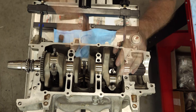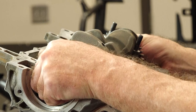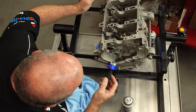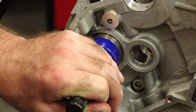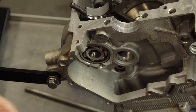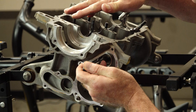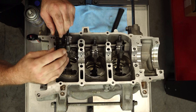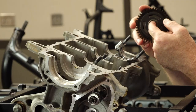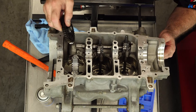What we need to do now is get this cleaned off, but before we can go any further with the crankshaft, we need to get the counterbalance in place. Because without it there, you can't get the crankshaft in — it has to go in first. So let's go ahead and knock that out. Let's start by getting this bearing down on the end. The trick is to make sure you drive it in straight, otherwise you're going to be here for a while. Let's get our gear down in place. The real trick here is when we're feeding the main shaft through, this gear needs to go on but it has to be held in place as you're pushing the counterbalance shaft through. You'll notice there's a channel right here, and then you will see a dowel on the shaft itself — and that's where it needs to line up.